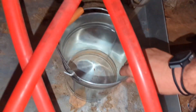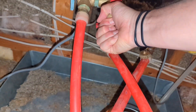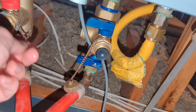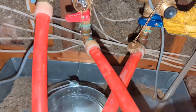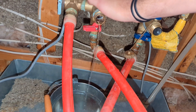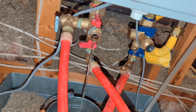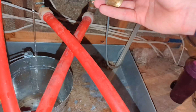You're going to get a bucket and take the caps off. I don't know why but the hot one is always harder. And it looks like I've got a little leak-by on that valve — and the chain broke. I'm going to have to fix that. So you want to start draining a little here, and as you drain a little there, open it up some more.